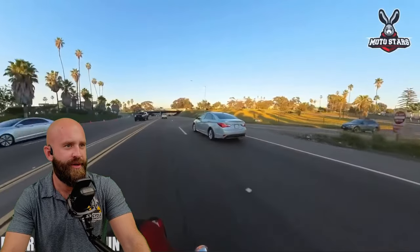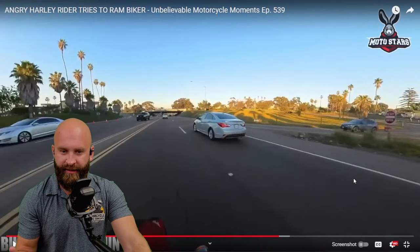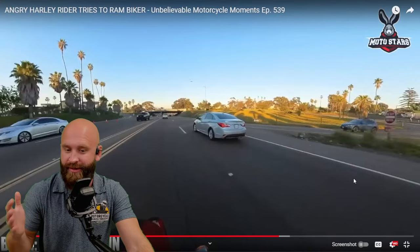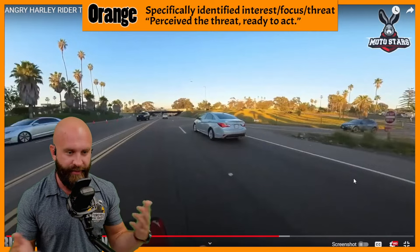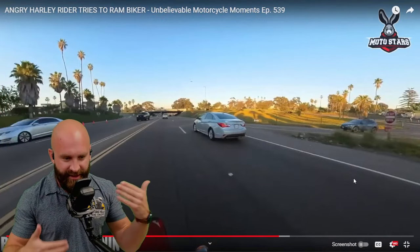Open lane, merging. They're going to switch lanes on us. Yep. Good job accelerating through your escape. So what I was saying here is it's a merging area. This vehicle that's in the right lane is going to move over because they don't want to get hit by the other vehicles, and they're being nice to let them in. So when you start seeing that stuff, you're in orange stage because it's an intersection, right? It's a merging area, path of travel violation possibilities. We can see this pattern coming up.